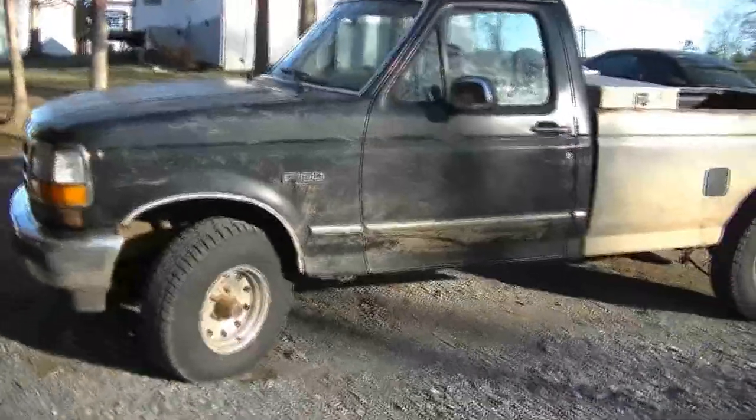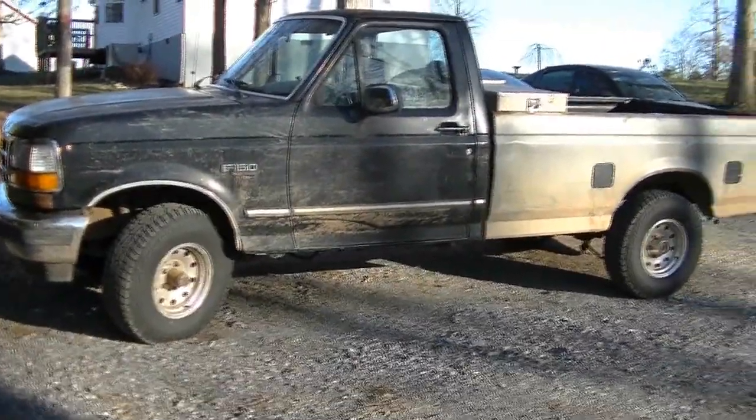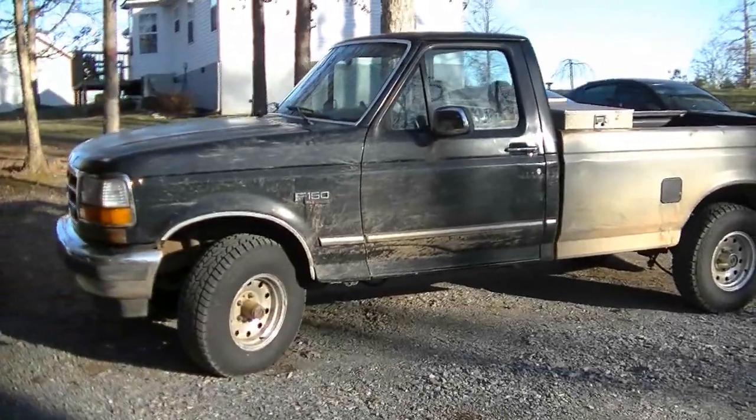With the 5.8 automatic. I bought this truck for a thousand off my dad — he had bought it for 700. It wouldn't shift into overdrive and was missing real bad. Also, when you would turn the headlights on, the truck would die. He found out there was a ground arcing off on a hot that was causing the truck to shut off when the headlights came on. Fixed that, found out a fuse was blown for the overdrive, fixed that, found out spark plug wires were accidentally swapped and that fixed the missing. So we fixed it pretty much for free.